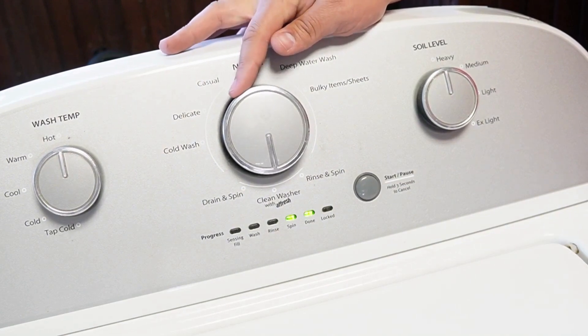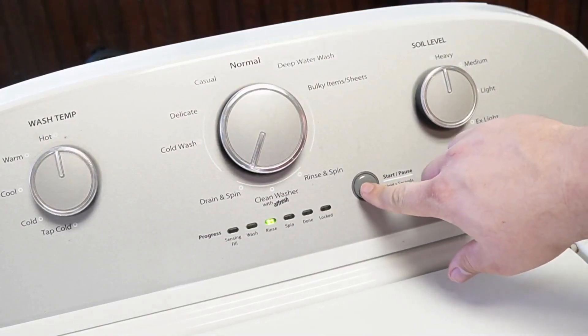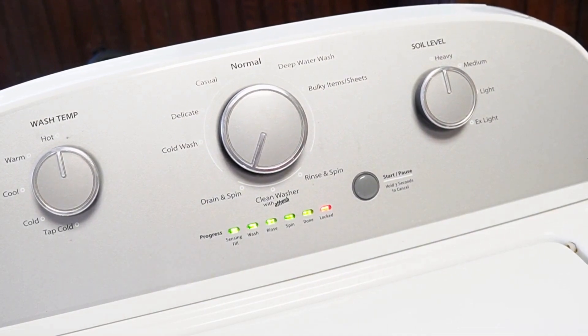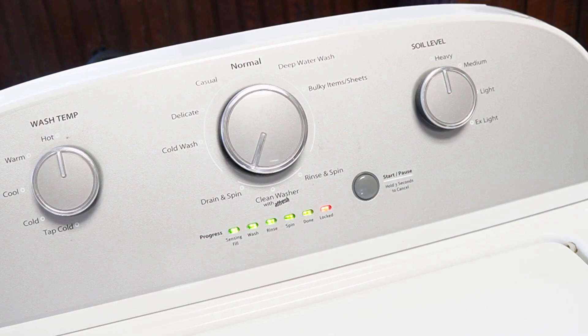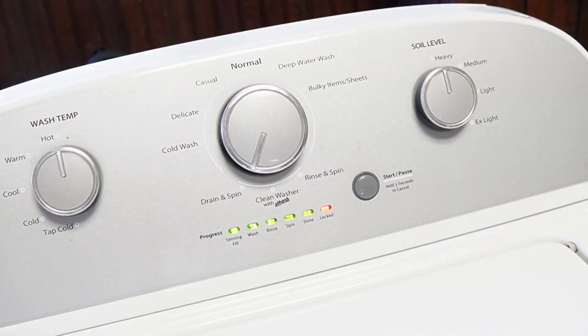Once you're in this mode, turn the knob clockwise four times. The rinse light should be the only one illuminated solidly by itself — this is the recalibration mode. Once you press the start button here on the rinse mode, the door lid will lock and it will begin a series of tests and operations on your washing machine. All these tests take approximately three minutes to run all the way through. As the recalibration mode runs, every part and process on this washing machine is going to be run, and the machine will physically reset all the components to a default state, allowing them to run at an optimal level. This is a must when parts aren't working right or the machine just doesn't know what state it's actually in, like if you've replaced the shift actuator or even a control board. During this time, you're going to hear all kinds of noises from the machine, and that's totally normal during the approximate three minutes.